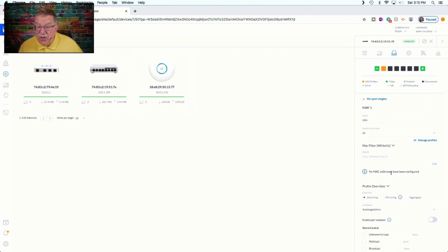The interesting thing that I noticed on here is you do have the ability to enable mirroring. From a troubleshooting standpoint, I'm probably going to do a video on this one because this is an interesting troubleshooting tool. It takes all the traffic showing up at a port — inbound and outbound — and copies that to another port. So you could have some sort of network sniffer. If you've ever heard of Wireshark, or Ethereal, which is the earliest name of Wireshark, this allows you to plug in and be able to sniff what's on the network. There are pros and cons to using the mirroring port, and that's a whole other video.